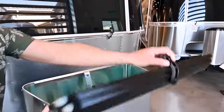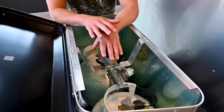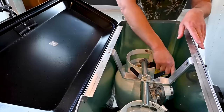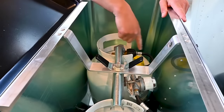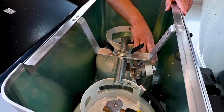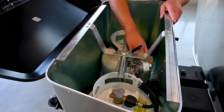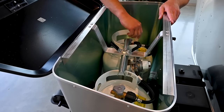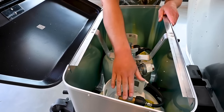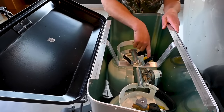Just lift the tether up and it gives you access to your propane tanks. These are a similar size to what you'd use in a barbecue — five gallons each. There's an auto switchover. Right now it's pointed to one bottle; if the sight gauge is red the tank is empty, green means full. Once one tank is empty, you can manually switch it over to the other bottle, or leave them both on for auto switchover.